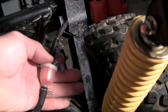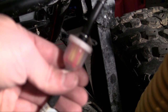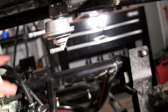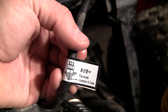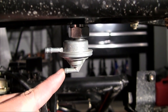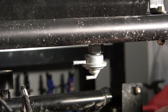Usually two hoses are hooked up to the gas tank. You can tell which one is the main fuel line because it has a fuel filter right there, which is responsible for getting any crummy crap out of the gas. This one right here says 'oil outlet.' And where this is going to go is the top right here — that's where the main fuel line goes. Now, the second one is for vapors and it says 'vacuum connection.' This one goes on the intake valve right below it. So the vacuum goes on the bottom, which is responsible for capturing unwanted vapors, and the main fuel line goes on the top. The job of the main fuel line hose is to take the gas from the gas tank and pump it into the engine.